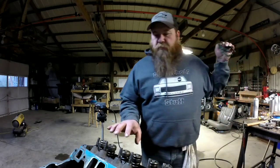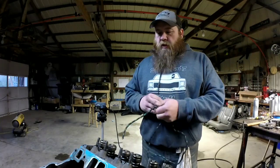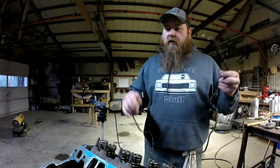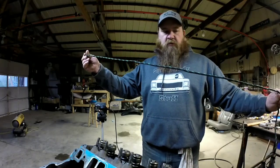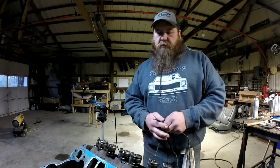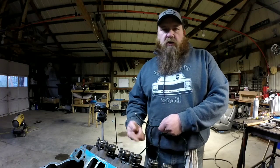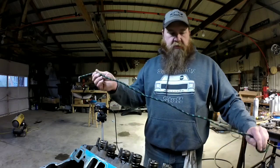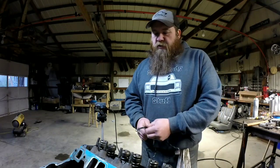The other way to hold the valve in place is to take a piece of rope. This is actually how I've done the other seven cylinders — I've already got seven of them done and saved the last one for the video. I bring the piston up to almost top dead center and just shove this rope inside the spark plug hole. Make sure you've got everything around the spark plug hole cleaned off so you don't get your rope all dirty.